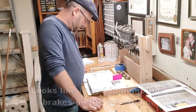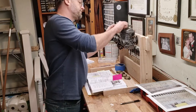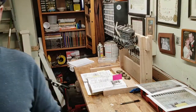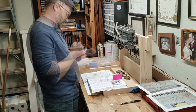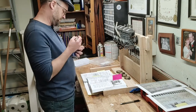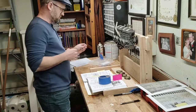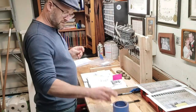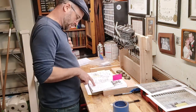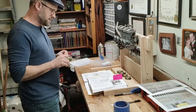Remove the idle adjust screw and spring. Let's write this down. There was a lock washer there that I don't have. I bet I'm going to need more than just this. That was step one: remove idle adjusters from spring. It doesn't say anything about a lock washer. Missing from my assembly.